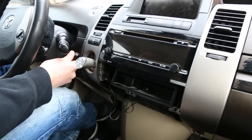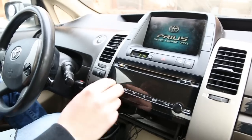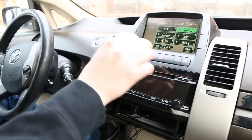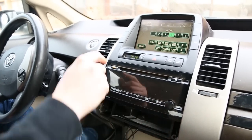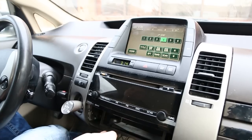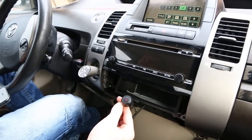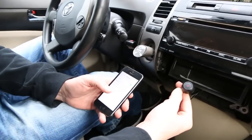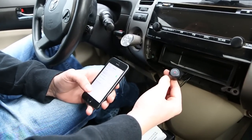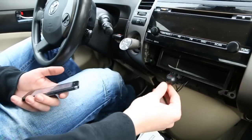Now we're going to turn the car on to its first position and go to the audio. We're going to press this button twice and it's going to go to the CD changer mode — that's where you need to be to use the Bluetooth. When the Bluetooth is not paired, the LED light on the button is going to be flashing rapidly. We go into the phone and see GTA Car Kit — we pair to it, and once it's paired the light is going to be solid red. It's been paired, so this light is solid red, and now you can use the Bluetooth.